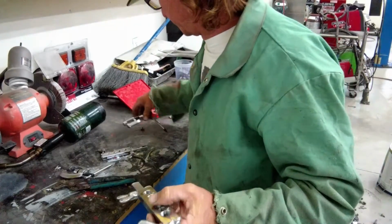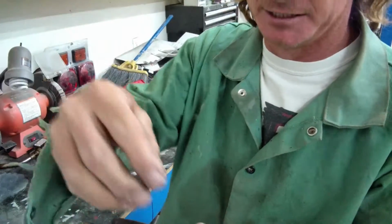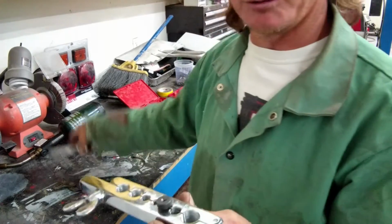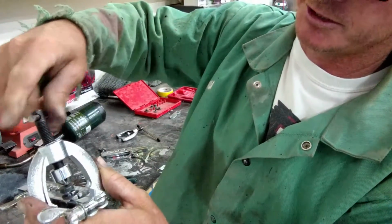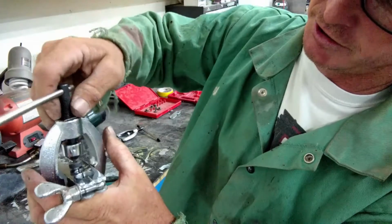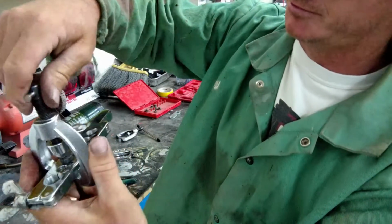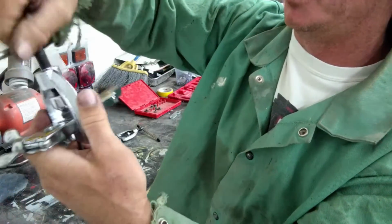That's all you need. You're going to come back with your inverted flare tool. This little guy here, it'll go on there, nice and neat. Come back with the second anvil. Drop it straight down there on top. Make sure she's centered. Kind of stubborn here. Nope. There we go. Centered in there in the anvil.